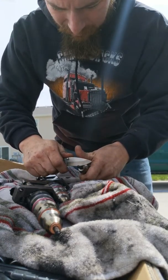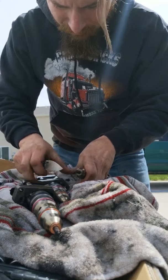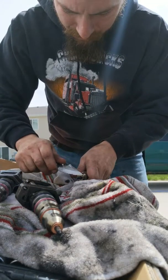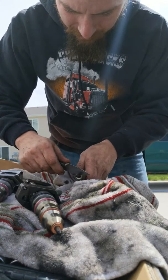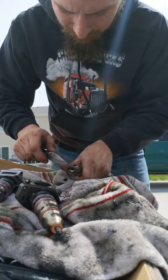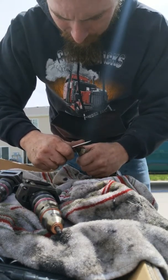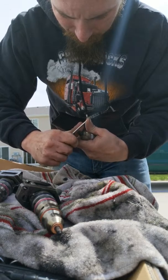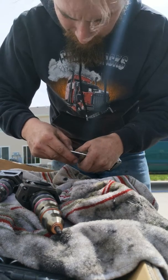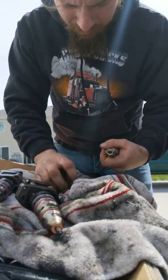I've been taking a knife — and I don't know if you're supposed to do this or not — but I'm just getting all the crud off of it, real lightly. I'm not pushing the blade towards it to cut into it; I'm just dragging the edge over it to kind of knock some of the heavy stuff off. It's taking quite a bit off. Do the same thing right here at the tip, where the fuel actually goes in, to keep those holes from getting plugged up.